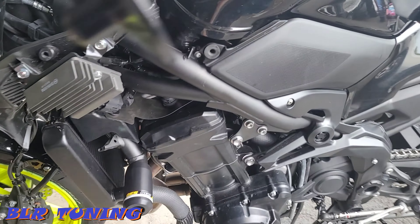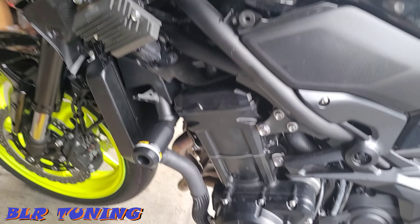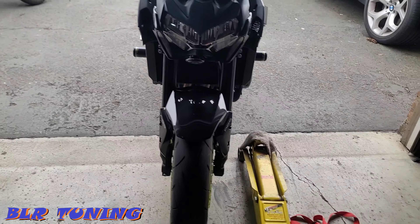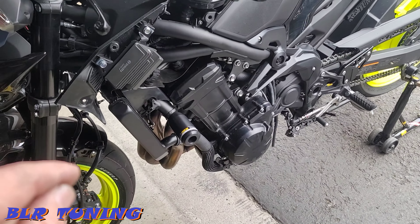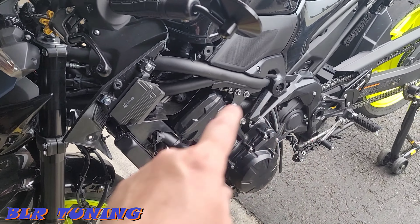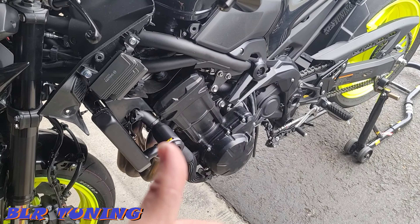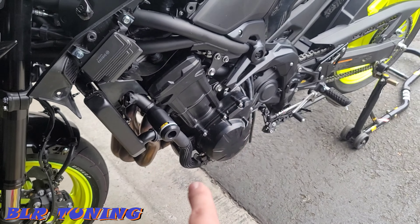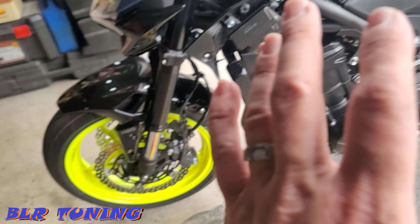The bike's a little disassembled, but go check out oesaccessories.com — you can also find these on Amazon. Pretty cool look to the bike; it matches the little offset on the wheels with that yellow. Like I said, when you pull a bolt out the motor can drop — and that is exactly what happened here. We had to loosen up all the engine mounting bolts and lift the motor back into place to put the bolts back in.